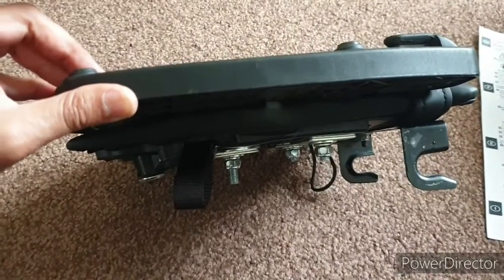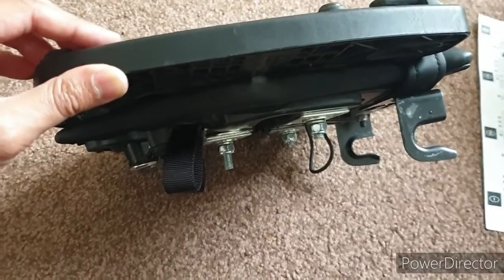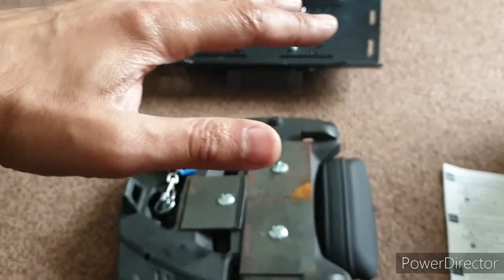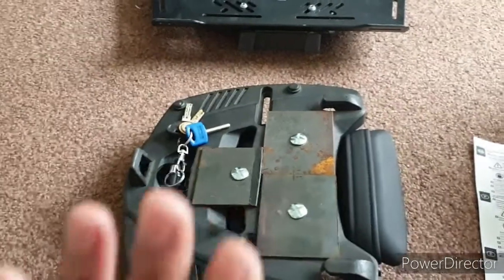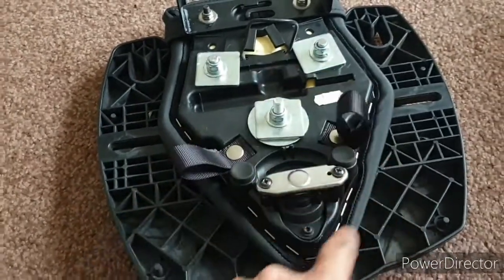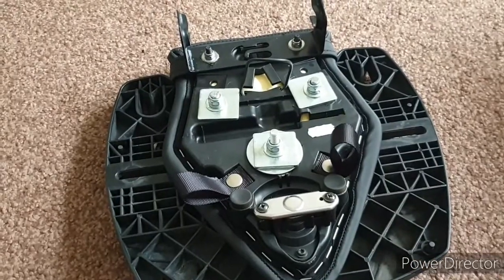But when I travel I've got a week's worth of kit, tools, my chain and disc lock, all of which adds up to substantial weight. When you imagine this fixed onto the seat and then on top a 47-litre top box with all that kit — probably the better side of 20–25 kg — just being pushed and pulled forwards and backwards, is this plate secured through this piece of plastic, held only by three Allen bolts and two self-tapping screws, going to be sufficient? I'm not convinced it is. So I thought, ditch it.